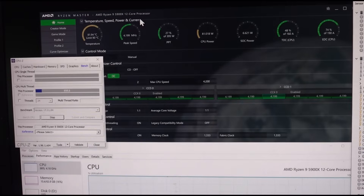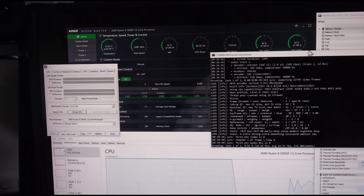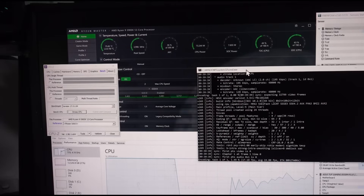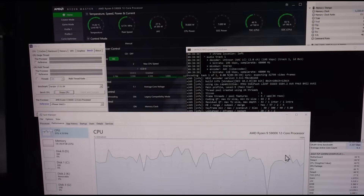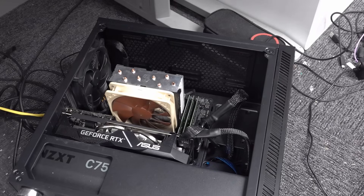In this video I'm going to upgrade the cooler. I'm currently transcoding a 4K video using Handbrake with X265. The CPU does jump around — my original BIOS settings had it maxed at 4.2GHz all the time. It doesn't get as hot doing this because CPU loading isn't 100%. These temperatures are all measured with the side covers on, and the airflow arrangement inside the case is a bit how-you-doing. Here's the inside of the case.